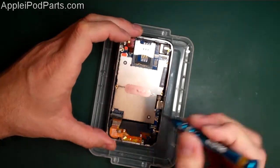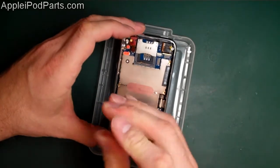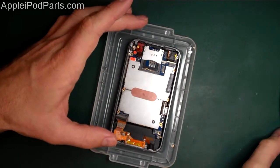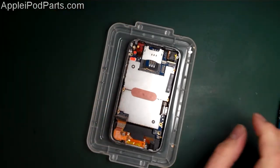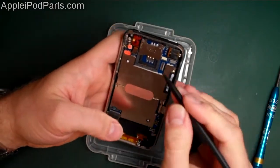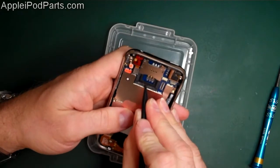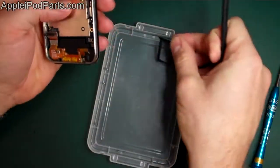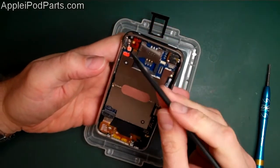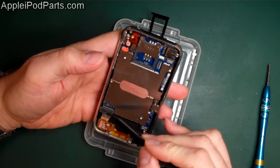So now that's the case, we can remove that last screw down here, and that should lift out and drop into there. While we're at it, we are going to want to remove the SIM dock - the SIM card holder - because that will stop the board from coming out. Now you can pop your clip in there, or we can just give it a little bit of a nudge from the back - pops out and off it goes. So we've got the screws out, we've got the SIM tray out, we've got the connectors off - all the connectors are off now that need to be.